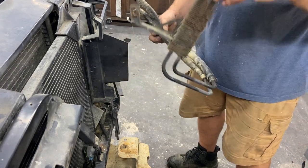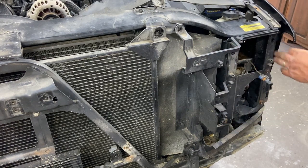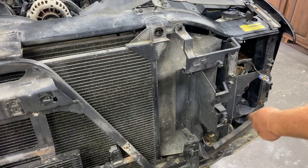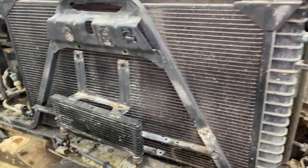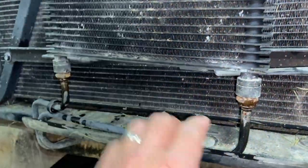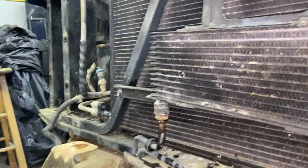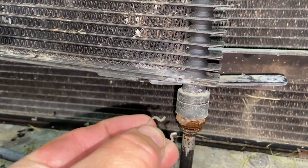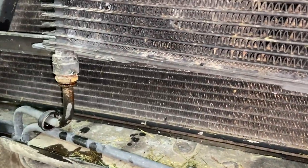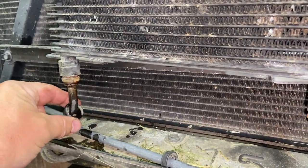There we go — power steering cooler out. So we're going to take these plastic pieces off to give us room to work. There's Torx heads, two of them at the top, and then 10 millimeters on the rest, with a couple of plastic clips down there, and that'll pop right off. Since I was so successful with not destroying the power steering cooler, I took a closer look at this — it's pretty simple to get off, you just might have to wiggle it a little bit. There were those bolts that hold the bracket in place and then down here with some of those plastic clips, right in this groove. Once they come out, this whole thing will just lift right off of your hoses. And of course there were these little plastic caps over top first that I had to remove.